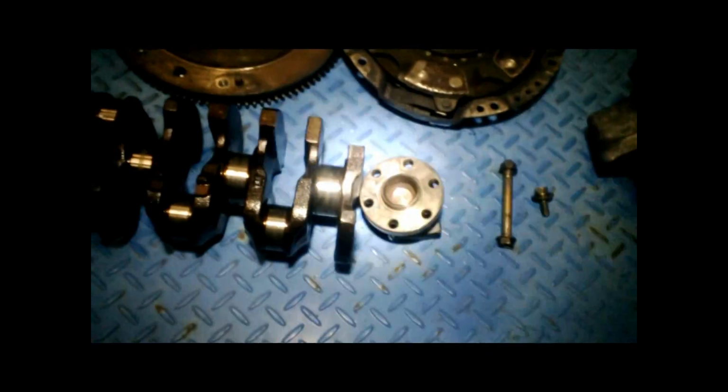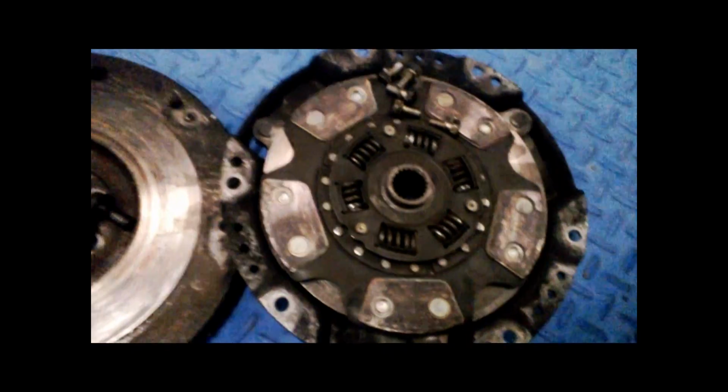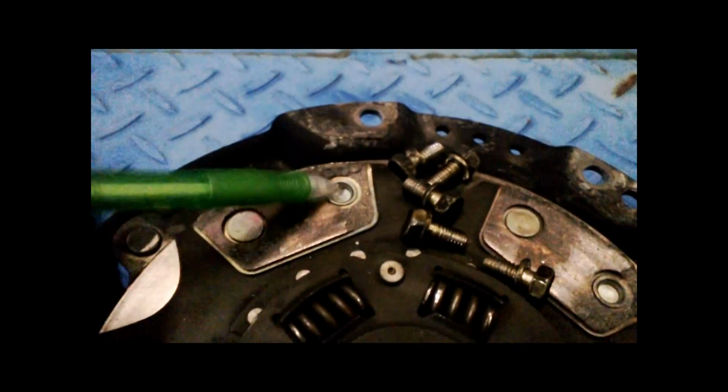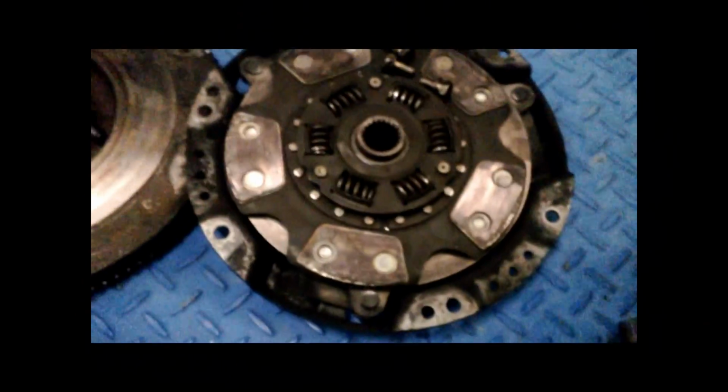Starter motor. So what's happened is the crankshaft has snapped off, and so the flywheel is bouncing around in the gearbox. The clutch is all damaged, so I'm not happy about that. You can see here all the ceramic has been smashed off. Also around here, all of them, all on that leading edge as well. So the clutch is gone, a throwaway item.